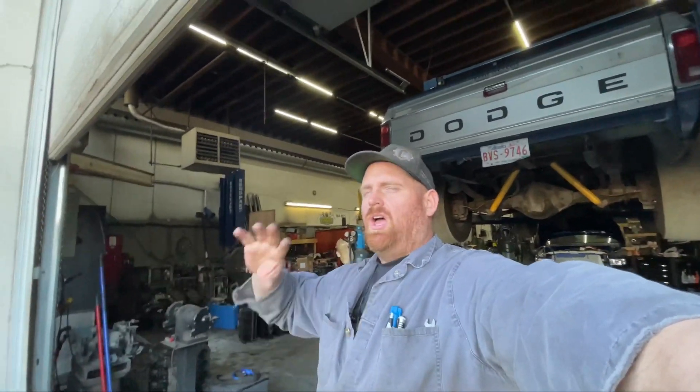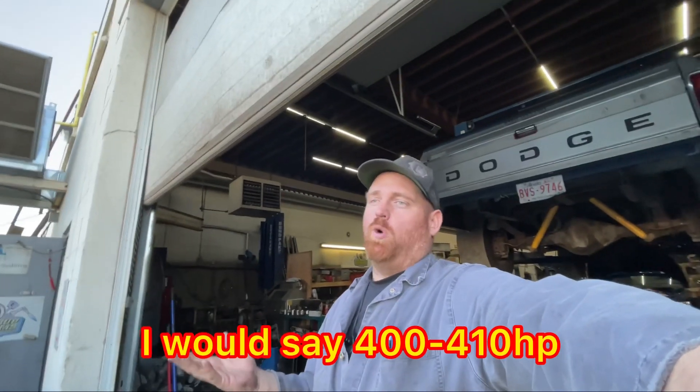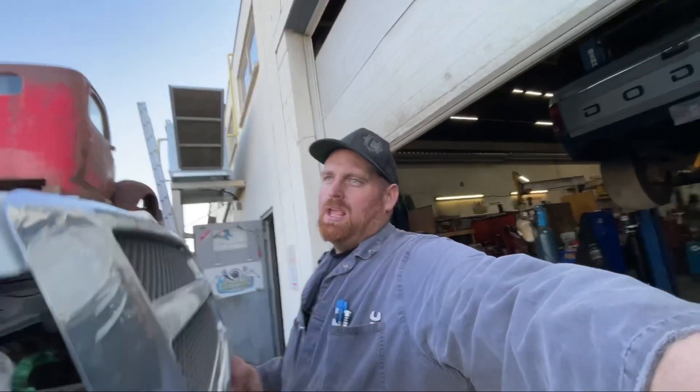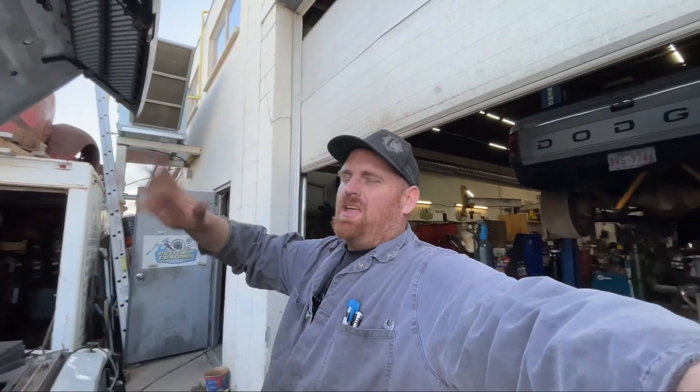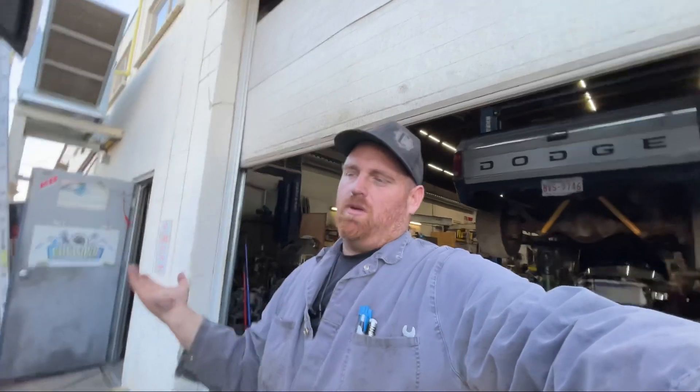We're back from running around. I already showed you the draggy results. It makes a little bit more power, not anything crazy — I haven't figured that out just yet. I'm going to figure out the pounds and all that stuff versus how much faster we went. It's not going to be a crazy horsepower difference, but it definitely makes more power, better power through the curve. The drive pressure at 40 to 45 pounds above that — the K27 turbine kind of runs out of air, it just can't move any more air.